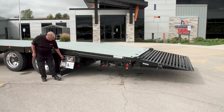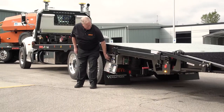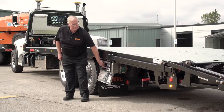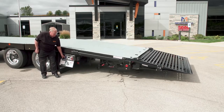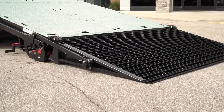The deck is locked for travel right now. Release the deck locks — they're locked in place by the weight of the bed right now. We'll raise it up just a little bit to cause the deck locks to release, then lower to the ground. You're ready to load.